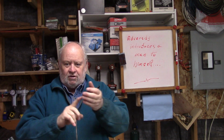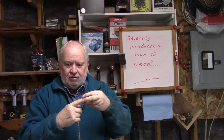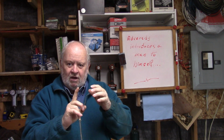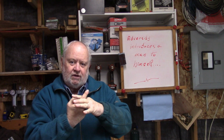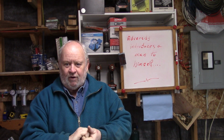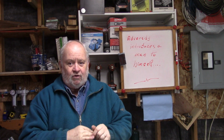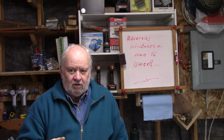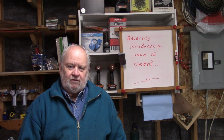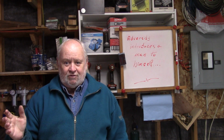So you notice when we were working on it, we put grease on the drill. That was the only part of the video that I got, was drilling the hole. We put grease on the drill. Well, the shavings then would get caught in that grease. And then we also put grease on the tap and whatnot. So I think we were very good. We managed to keep all the shavings out of the transmission. I'm pretty sure we got 100% of the shavings out of the transmission. So anyways, I think we did a really good job repairing this.